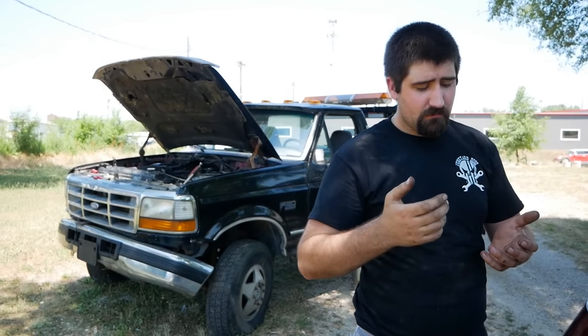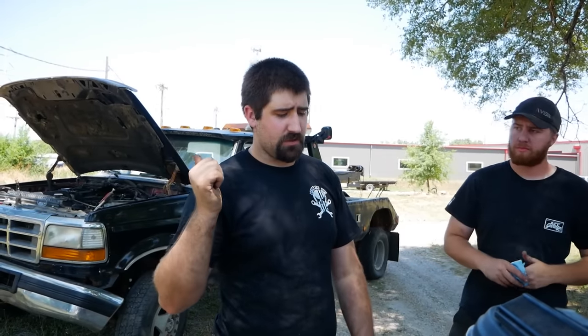I wouldn't say I deal with this a lot, but in the older fuel systems, like this truck is running with a mechanical fuel pump. In 1994, they were running a higher sulfur content in the fuel, which acted as a lubricity. Think lead in gasoline in the 70s. It kept things lubricated in a weird way. That's what sulfur did in mechanical fuel pumps and injectors on these trucks.